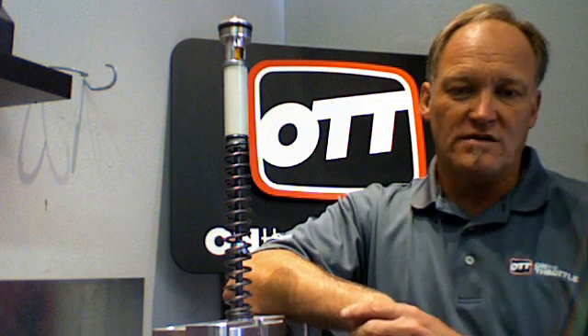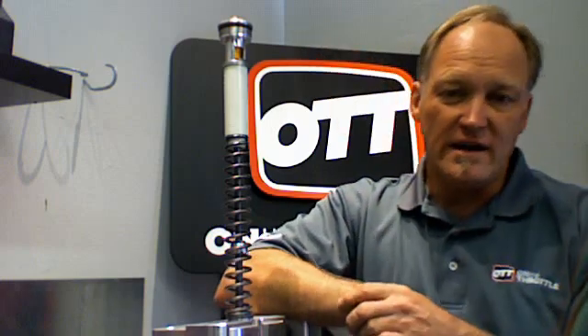Our range of adjustment in this instance is eight millimeters. That means when you add preload — if the bike sits and you put a zip tie on it — when you add all the preload to the fork, the fork will extend by eight millimeters. Some forks you can add all the preload and they won't move, and that's a long story about top-out springs which we're not going to get into in this six or seven minute version today.